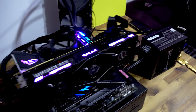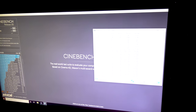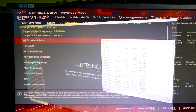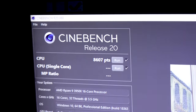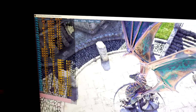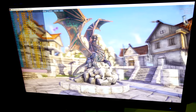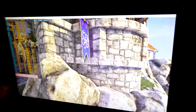The 450-watt power supply is starting up okay, but that's only a small part of the equation. We're now running a Cinebench test to check the CPU for any hiccups — 8607 points, looks all right. Cinebench R20 is a quick CPU test, but we also want to stress the 2080 Ti, so we're running Unigine Heaven and leaving it on for about two hours before moving to further benchmarks.